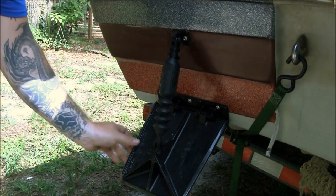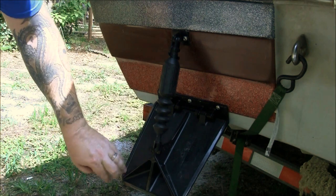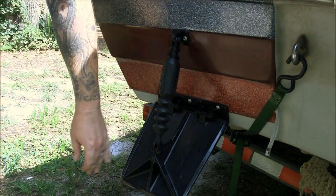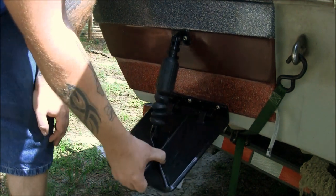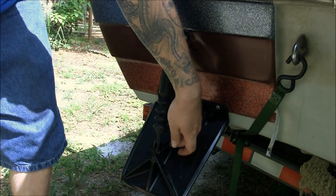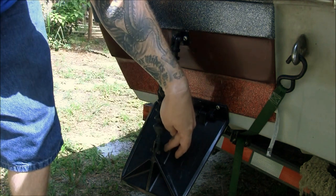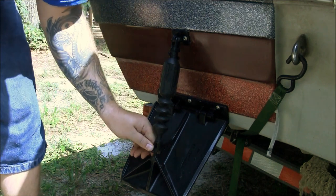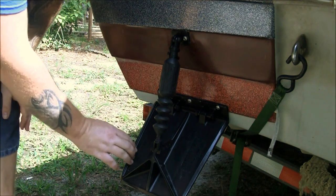It's one of the easiest tab installations I think on the market. You don't have to install any pumps or any electronics — it's all gas pressure driven. As you ride your boat more and figure it out, you have different adjustments here. Pin all the way in is your tightest, which is your full 80 pounds, and each notch out is going to reduce the pressure. So there you go — doing an open water test here soon to show you how it works.